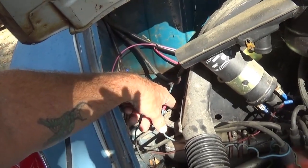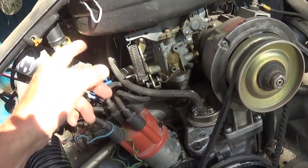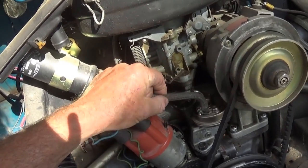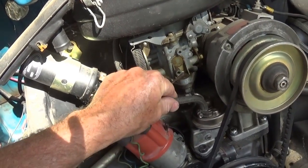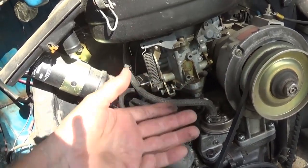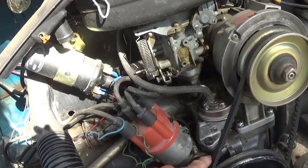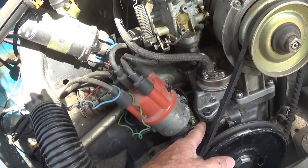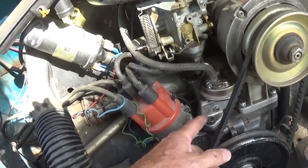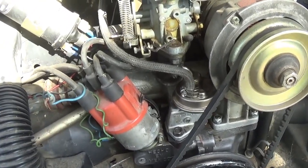The fuel line comes through the firewall as steel, then goes to the woven line, then to the fuel pump — you want all of that insulated. If the woven line isn't available and you're using a different kind of fuel line, you could wrap it: take another fuel line cut lengthwise and put it over your existing line, or use electrician's plastic loom around your fuel lines. And the main reason I made this video: if that phenolic spacer is too tight in the engine block, it could be pinching your fuel rod and causing it to seize. Hope this helps somebody — thanks for watching, thanks for subbing, Easy Cheesy out.